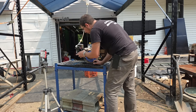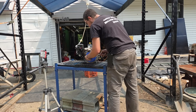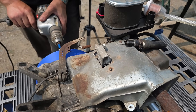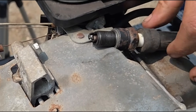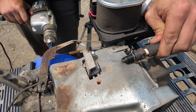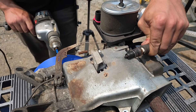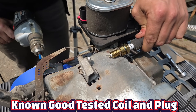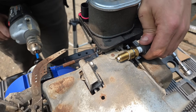Attempt number three, no choke. I haven't heard any kind of fire off this thing yet. Gap set way less than it was before — take two. I got no spark at all. Either that magnet is junk or the coil died on us. Let's see if chrome gets us home — I see no spark at all.